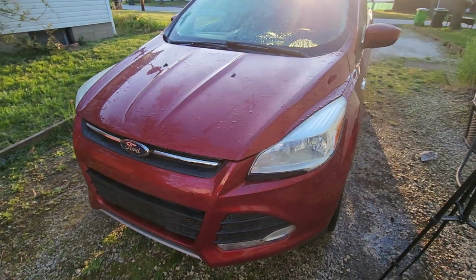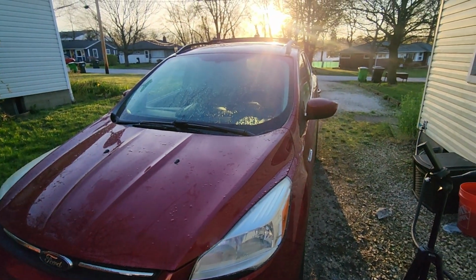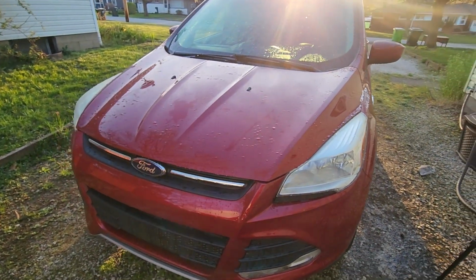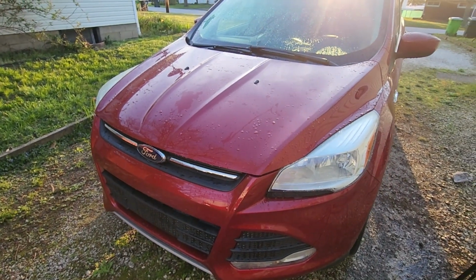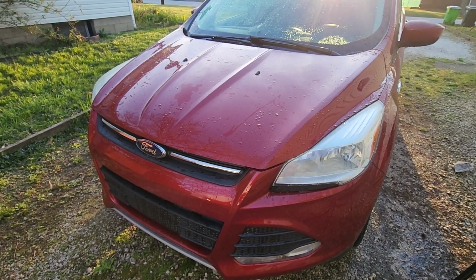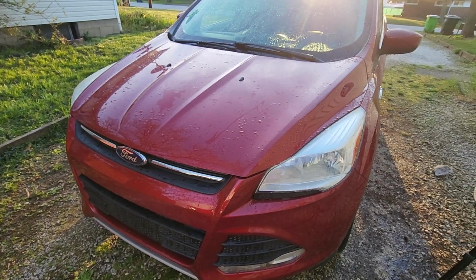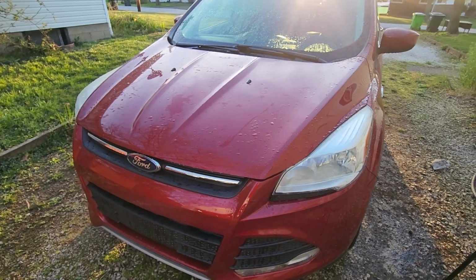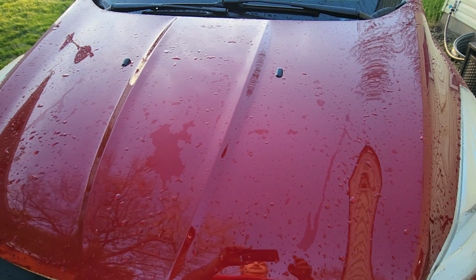So I'm choosing the lesser of the two evils. I'm going to go around. It's just dawn, so it's still very cool out. The APC dilution is not going to dry out on the car. I'm going to go around, spray down the whole car, let it dwell for maybe 2-3 minutes, power rinse it off, and then go to the wash. I'll bring you back when I do the final rinse to show you that the beading water hydrophobics has in fact returned. See you shortly.